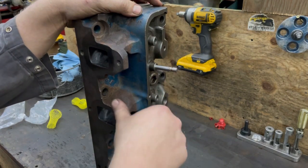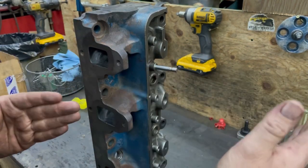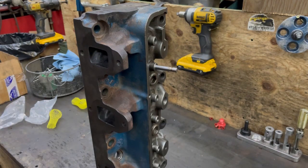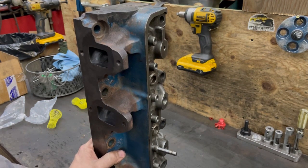What you do is chop a little bit off the end of the valve — that's the only way to put it in within spec. Usually the variance in spec on something like this is about 80 thou difference. I like to bring them into the middle of spec, because then as the valve and seat wear, you don't come out of spec. If you do go out of spec, especially without hardened seats, it'll start holding the valve open because the lifter doesn't have enough movement. That's also why I number them — if you chop 40 thou off a valve and then put that valve in a different hole that didn't need it, now you're 40 thou too low.